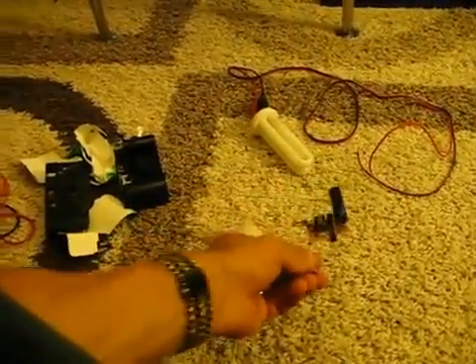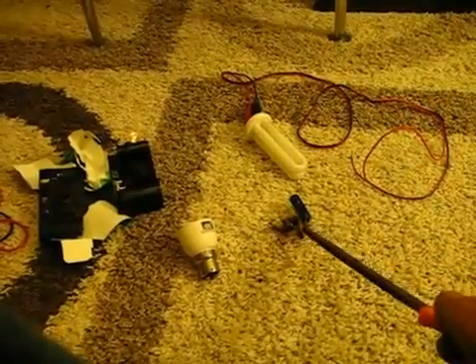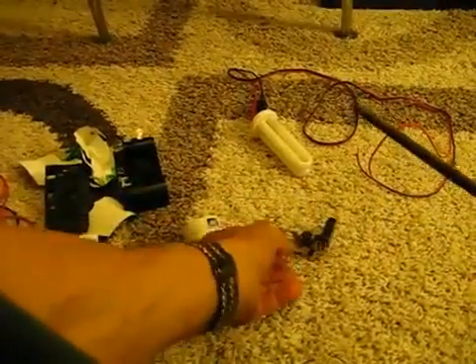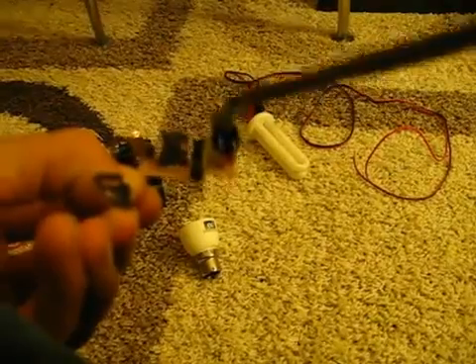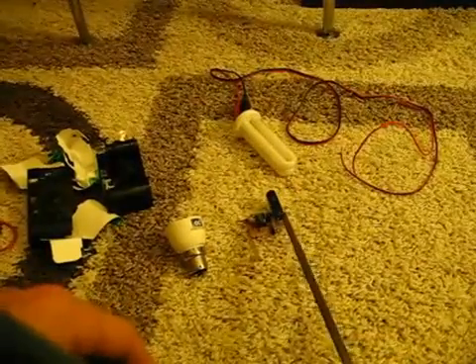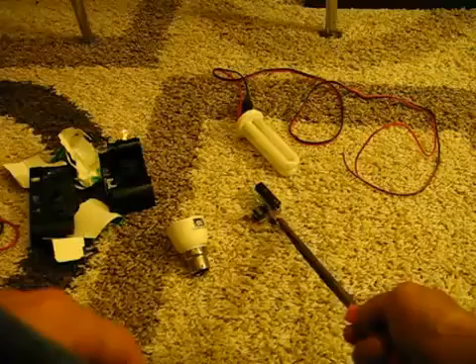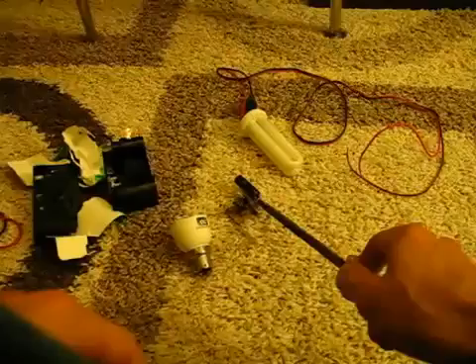Now be careful with this because this can give you a really, really nasty shock, and I'll show you how to deal with that. You best put it on the floor. You have something like a file or anything like that, and you're not bothered with the plastic handle, and just touch those two tabs on the bottom there. There's a tab there and a tab there on the bottom of this, which is a capacitor. It might make a spark and it might make a bang when you do this. Luckily, this one seems to be discharged already so that's not a problem here.